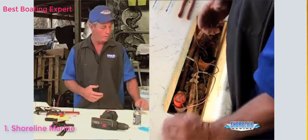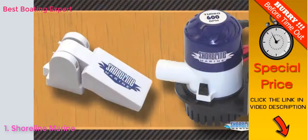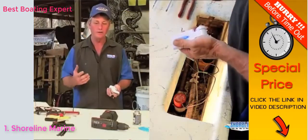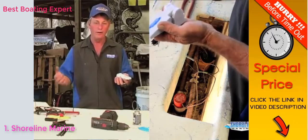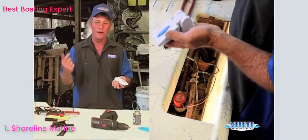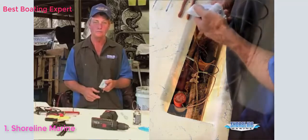While I'm replacing it, I'm going to go ahead and install a float switch in it so I'll have an automatic float bilge pump also. And be able to not worry about it if I leave it at the dock and it starts raining. I know my float switch is going to turn my bilge pump on and pump me out and not have to worry about coming out in the middle of the night and flipping my bilge pump on to get my boat pumped out before it sinks.